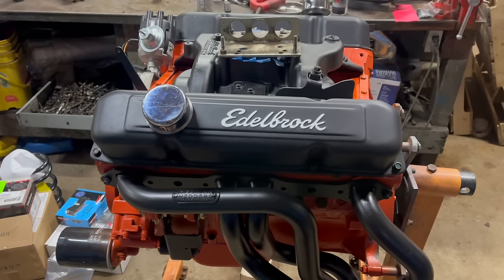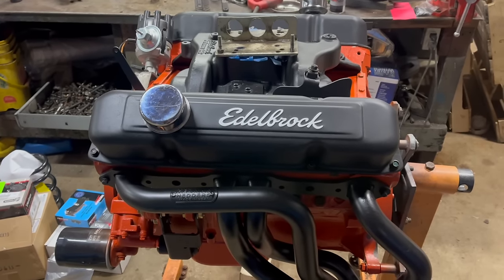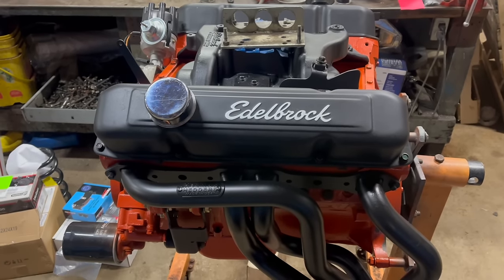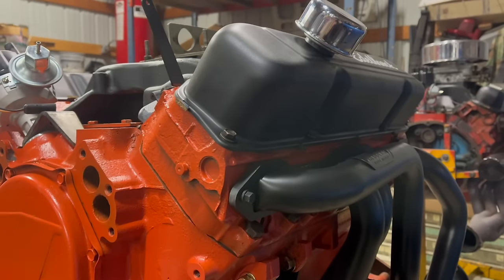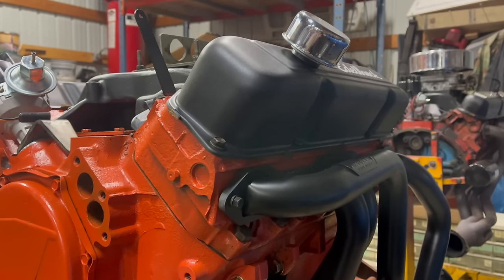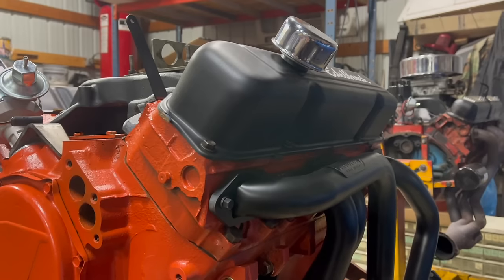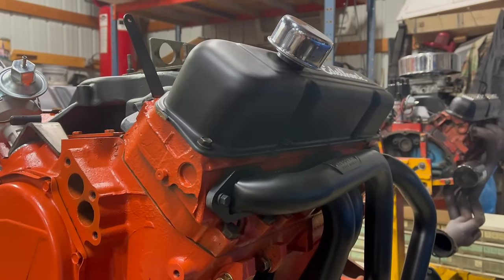We had to bore this engine to 60 over. It was already at 30 and the bores looked terrible. So it got new pistons, balance job, you know, basic stuff. Oh, I also did a video on these cylinder heads. They got a basic port job, set of springs, I blocked the heat crossover. Nothing fancy, but I think they're gonna work pretty well.